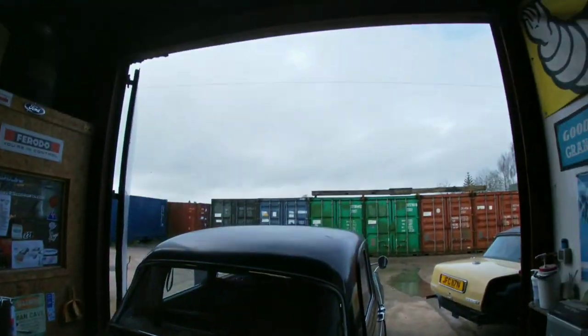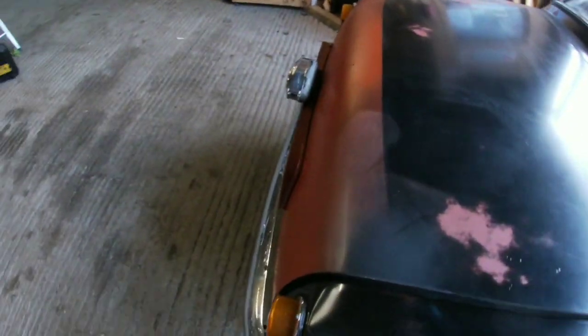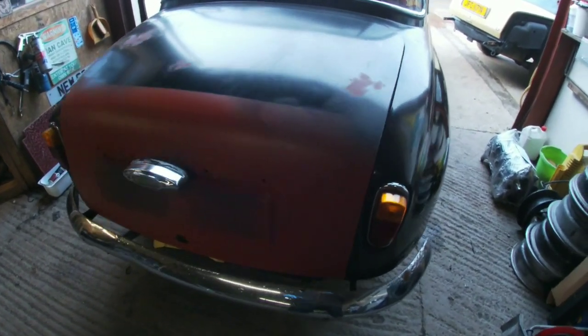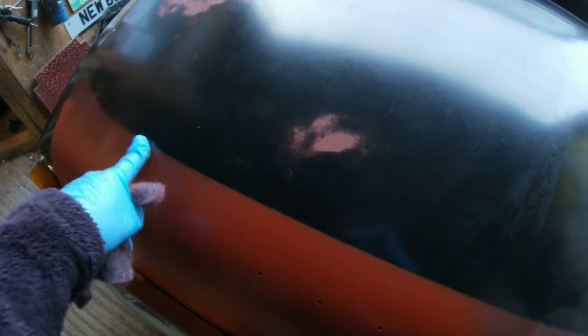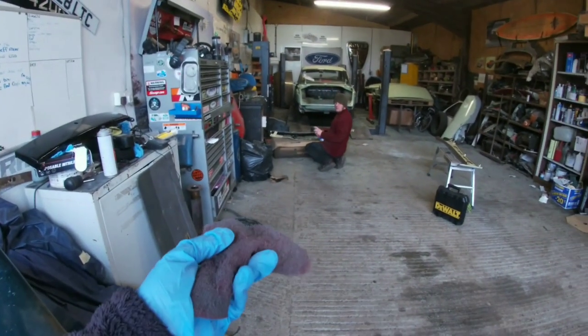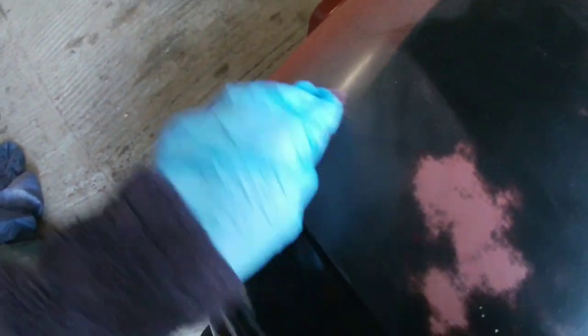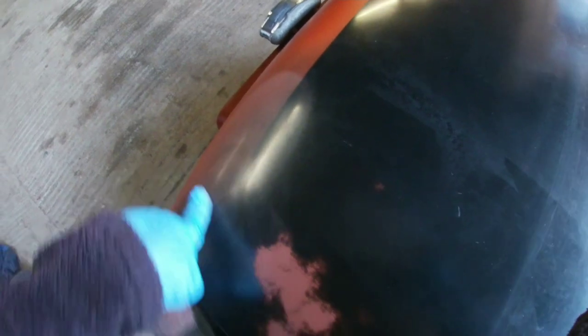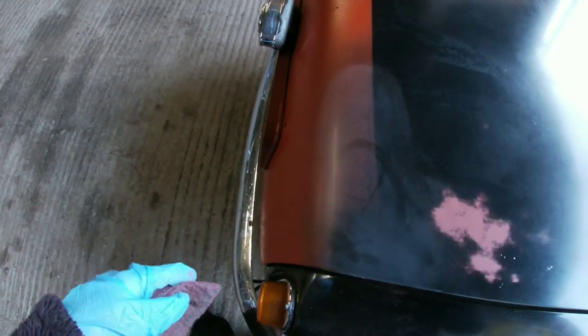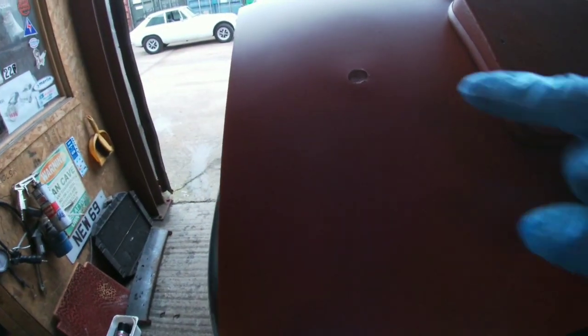It's the next day. I'm at Burry and Classics because I don't trust the weather today. We've got lots to do — panels to put back on, a spare wheel door, quarter panels — get all that back together. The overspray line here is not a thick line. I've got some Scotch-Brite here — not sandpaper — and I'm scoring up the edge of the black part and the primer to blend that in and get it ready for paint. Then I'm going to go all over the primer and score it up ready for the black top coat.